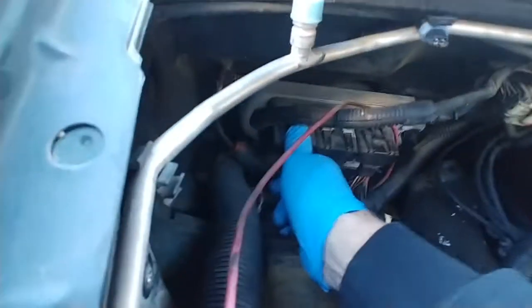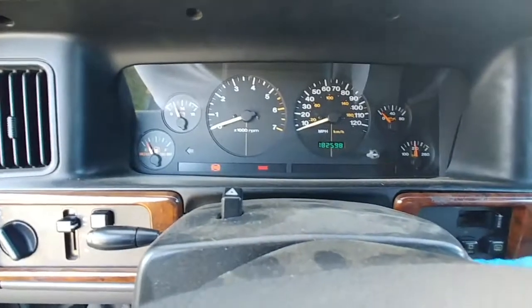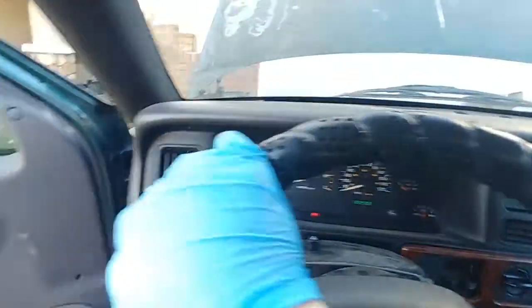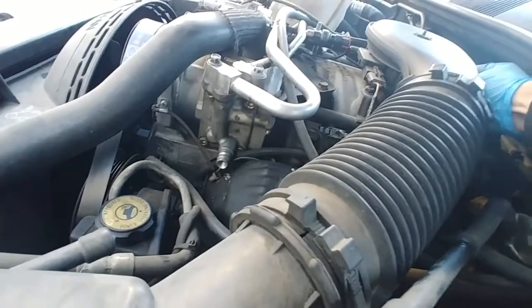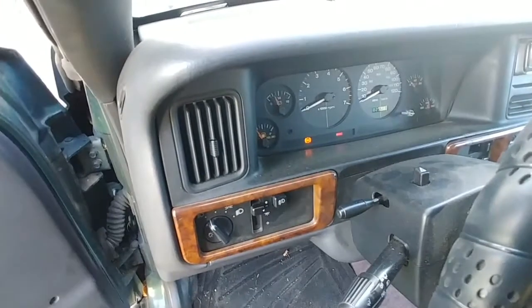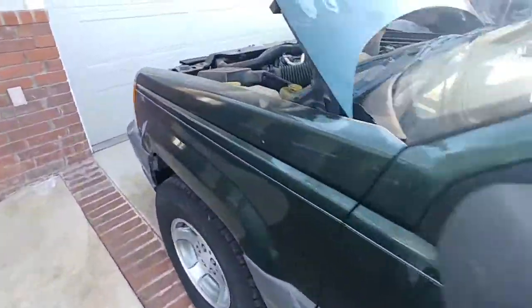So you can see how weird this issue is. I'm going to wiggle this last one. Let's see if it's some kind of connection. Is it the cold solder they talk about? Is it the IAC piece? I was about to change my crankshaft position sensor, but I don't know. Nothing. Wiggle this cable back here for the IAC. Just the IAC wiggle. Better — almost cranked over. Weird, right?